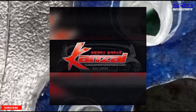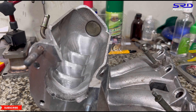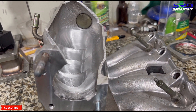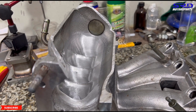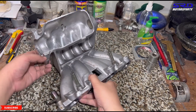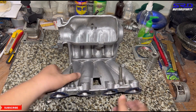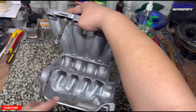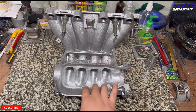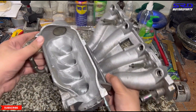After the finishing touches, here are the finished contours and shapes of the intake manifold before welding. You can honestly say that's a velocity stack entry, especially runner number one — it looks really really good. We know this is going to perform and flow very efficiently. On the other side and upside down, you can see the transition from the throttle into runner number four is really good — that's a velocity stack entry indeed.